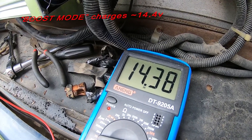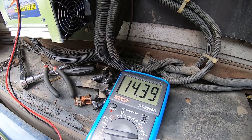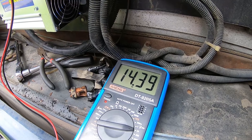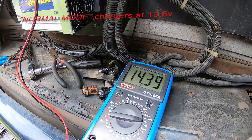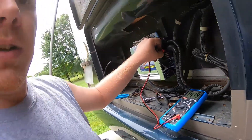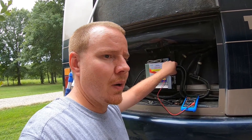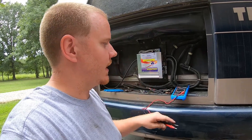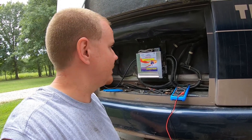We are charging right now — reading 14.3 volts. The batteries are at 12.6, which isn't very low, but this is going to put out 60 amps right now to charge them. Once it sees that they are close to being topped up, it's going to drop down to 13.2 volts, which is like a maintenance voltage — so it won't boil the batteries, they won't go dry, and it won't hurt the batteries long term. I'm going to keep an eye on this and go up front to check the battery voltage there too. Looks like we're good to go.